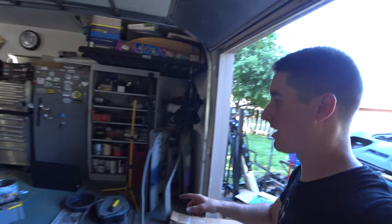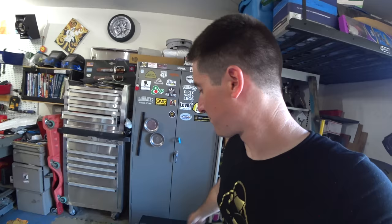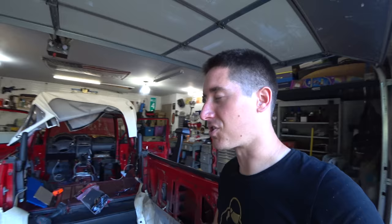And the thing lit up, and I tried the head unit, turned on the sub out, turned up the gain all the way on the head unit, nothing, swept the gain min to max, nothing. Hooked my phone up, turned the phone all the way up, nothing. So that sub is dead. Pulled the sub out, checked all the wiring, it's just done. So I called Crutchfield and they are shipping me another one right now. And I guess we gotta wait to make bass. Kind of sad about that.